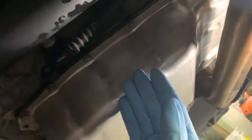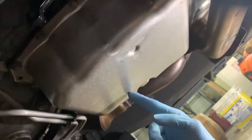I'm gonna do 40 first, and then go up to 80 just to make sure it's evenly torqued, so less likely to leak. But the sequence is, there's 18 bolts in all. I don't know if I mentioned that, but the sequence, you know, start in the middle, it's like a cross pattern. So here, here, here, here, here, here, you know, and you can go here and then cross, just crisscross